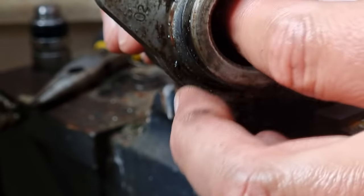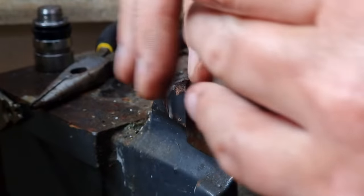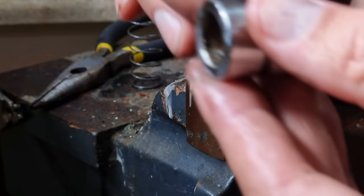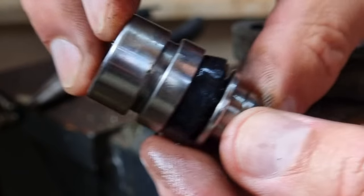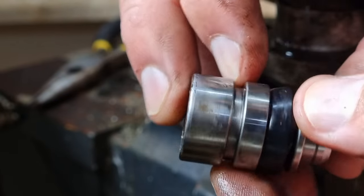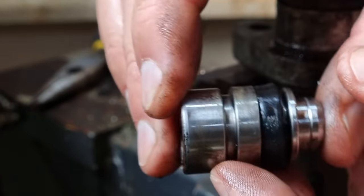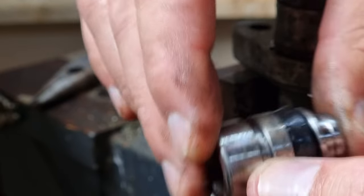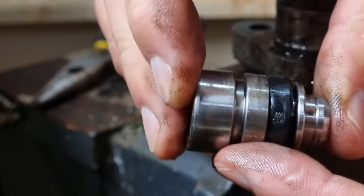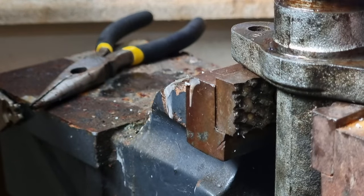Rust pitting has emerged on one side of the bore. As the piston tries to move up the cylinder it has drag on one side, which causes it to skew and jam. If I'm correct that there should be an o-ring on there as a secondary seal, that would further compound the problem — there's no secondary contact point to balance it out, so it's trying to push in the wrong orientation. That would certainly explain the heavy clutch pedal effort.